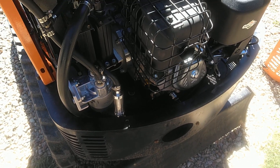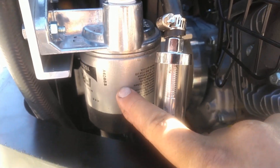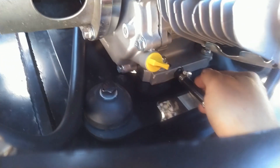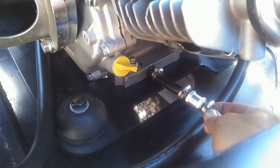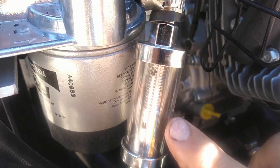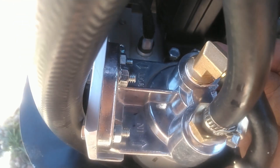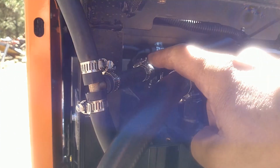I finished hooking up all the hoses, check valves, sight glasses, and everything. I pre-filled the oil filter and radiator with oil, and filled the engine to the top of the threads. Here's the routing: the barbed fitting goes into the bottom of the engine on the back side, with the check valve facing into the engine. Oil flows through the filter and up to the sight glass, then to the output side of the remote oil filter connection. The input side comes up to a T with the little air space, then across to the radiator.